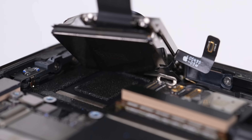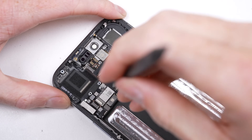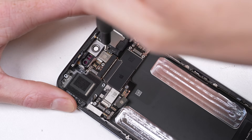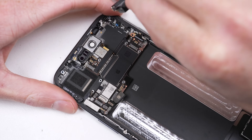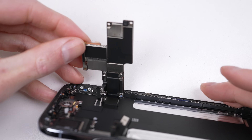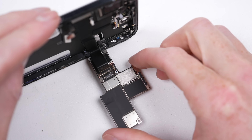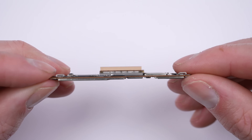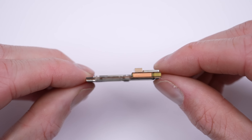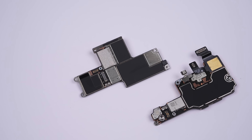Apple has chosen to adhere this microphone cable to the back of the camera, requiring delicate prying to separate. With the camera out, I'll continue working on the logic board removal. Like the Pro, this Air also has cables underneath its logic board — these two are for the display, which can be removed separately from the frame like previous iPhone models, allowing for straightforward display and back glass replacements. With the logic board free, we can see just how thin they managed to get it. The Air and Pro both have an Apple A19 Pro, 12GB of RAM and 256GB of storage. The board increases in thickness at the top, just like the phone, and when assembled, the larger section is nestled away in the camera plateau.